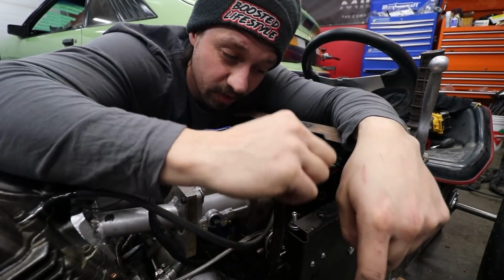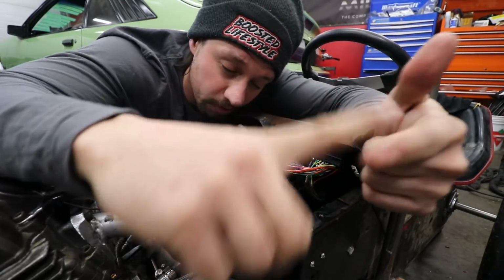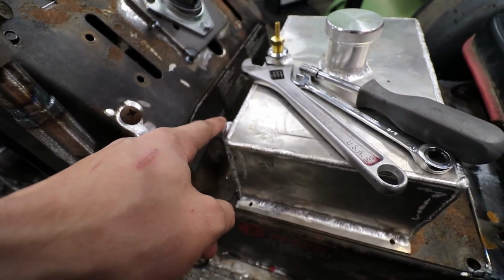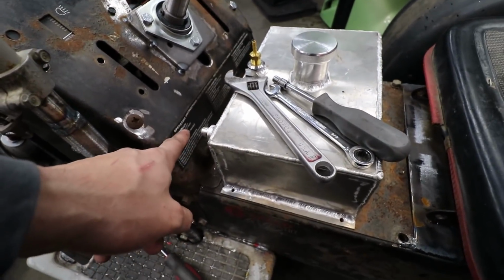So we're gonna go -6 from the regulator to the tank now, and then we have to figure out where we're gonna mount our pump and our filter to get to the other side. We have to drill a hole underneath, like behind this, so the line can just come straight through here and then go to the bottom. So take the tank up, drill a hole.